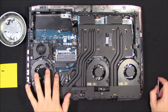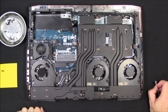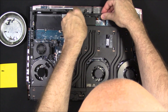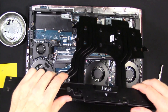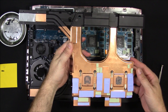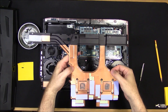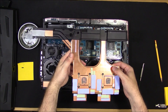I think that's everything. I'm going to have to remove the screws for this heat sink here. I used quite a bit of down pressure on a lot of these to get them loose, but try not to just sit there and spin hard and strip them out. Let's see how this thing comes up. There's the beast — it is a big solid block of copper. Apparently it's a vapor chamber in here. That's a lot of copper and a lot of heat pads. Very interesting.